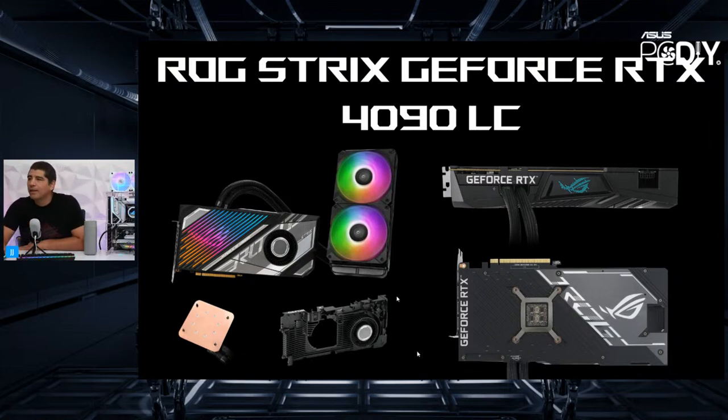Now, in terms of the RGB lighting design, you can fully customize and synchronize this through the Armoury Crate software suite. You have a high performance plate design, which makes contact with the GPU and with the memory. And then we have a specialized heatsink body that makes contact with the rest of the board level componentry. And then there's an auxiliary blower fan in there, which provides airflow across the PCB and the VRM components. So you have essentially two layers of cooling occurring, right? One from the cold plate, which is part of the integrated AIO solution, and then we have a kind of active thermal dissipation occurring between the heatsink and the assist fan that's there, okay?